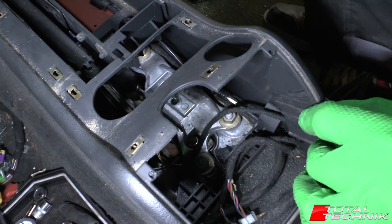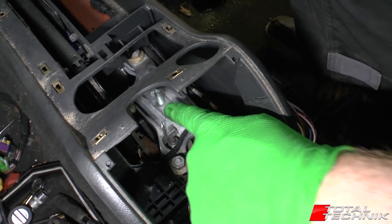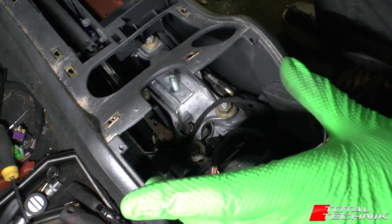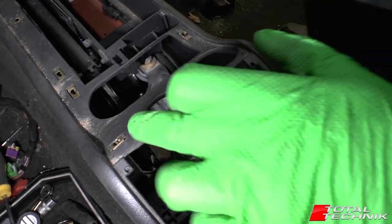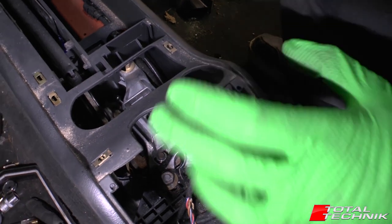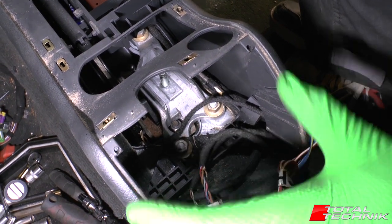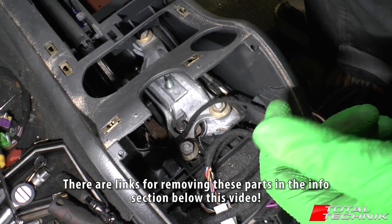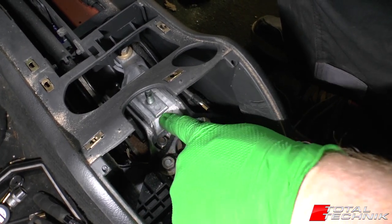When you come to remove this, you're going to be accessing it from the rear to actually gain access to the bolts to get this bracket out. You're going to have to remove the rear panel that sits in the back here, and also you're going to have to remove your armrest. You do not need to remove the armrest trim - that's the decorative trim that sits around the armrest - but you do need to remove the armrest itself and therefore also the rear panel. I've already recorded videos on how to remove both of those parts, so if you're unsure we'll have a link below.